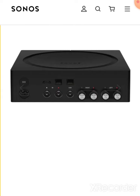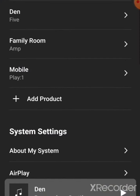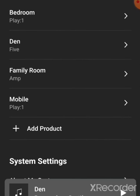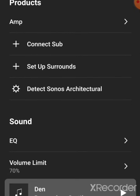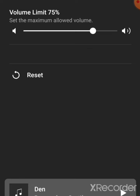To end this out, we're going to show you a few controls and recommendations when setting up the Sonos Amp. You've got the system itself — you're going to want to go down to audio compression and turn it off. Then, if we go to the Sonos Amp itself, if you have a sub plugged in it will show you subwoofer control. You will want to make sure that stereo/mono is set to stereo, because obviously you have two speakers. And you will want to use the volume limit function here to limit the maximum volume produced to prevent the amp from damaging your speakers.